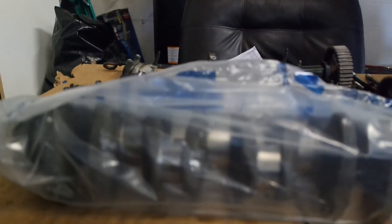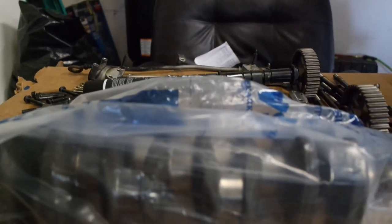The crank and the head had to be sent to the machine shop. So I got the crank back. Believe it or not, as much damage as you saw that block was in, the crank wasn't bad. He measured everything and it got polished — I think they polished it and shaved it a little bit. It was good, man. So it's all bagged up. I'm about to unbag it and start assembling. I think I'm going to start by opening up the King Racing main bearings and laying those in, then set the crank in and start assembling.